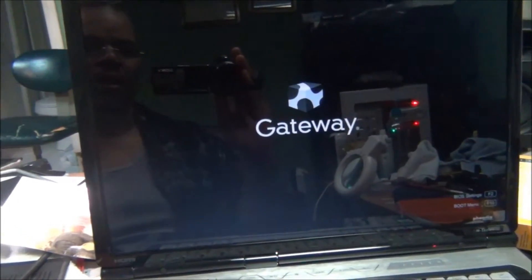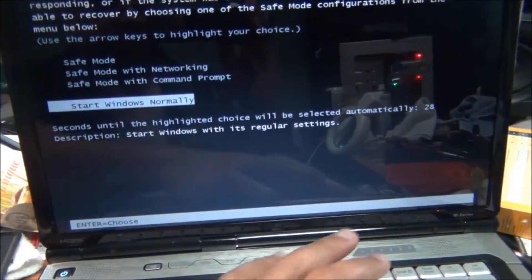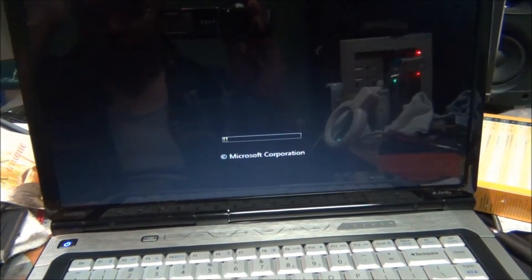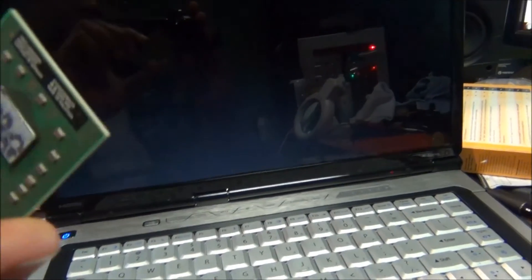Voila — fixes the issue! So there you have it. If you have a Gateway M-Series M1634U, and the motherboard made absolutely no beep sounds or sound whatsoever, it may well be the processor. This laptop was brand new, not even six months old when it died, and you would have thought by the way it was acting that it was a bad board — but it was actually the processor. Goes to show it's not always what you might think, and processors do go bad.